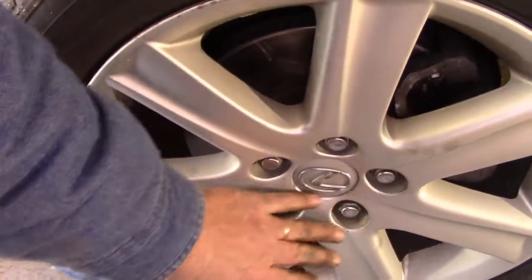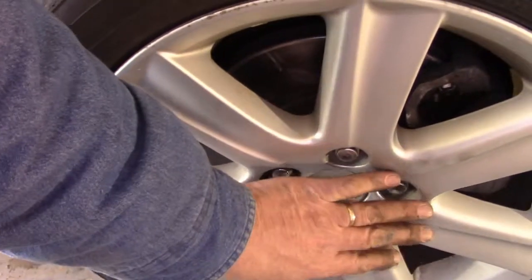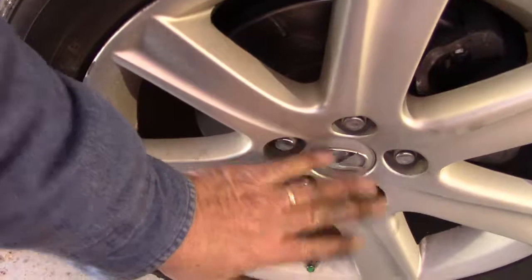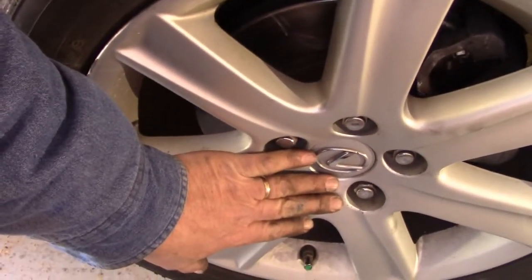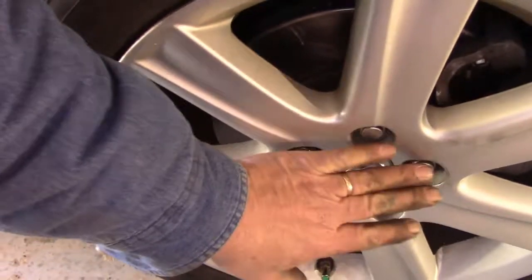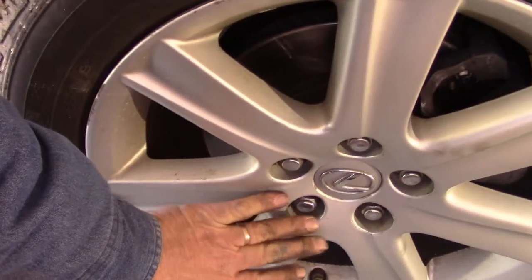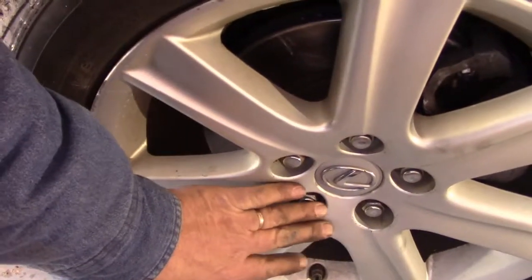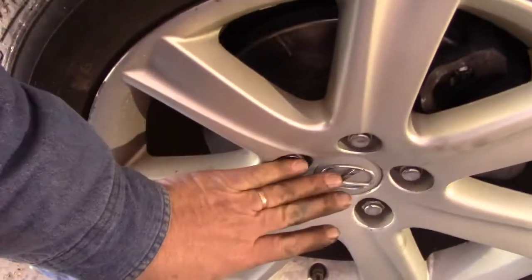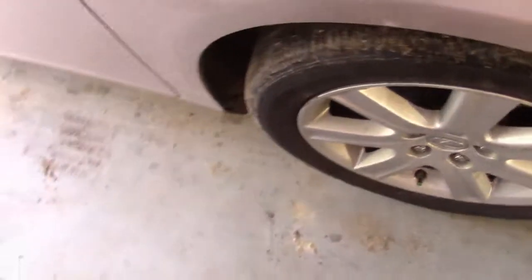and for whatever reason you can't get to the air wrench right away, or what have you, and then you might forget about it. So you might forget to torque your wheels to the right spec to begin with. So that is why it's a good idea to check that wheel torque after about 25 miles. Not only because maybe for some reason they loosened up, but also there is a chance that you forgot to tighten them up to begin with, and you certainly wouldn't want to have your wheel come off. So that's all we have for this job.